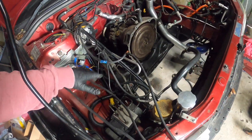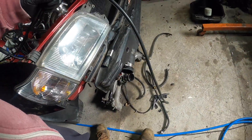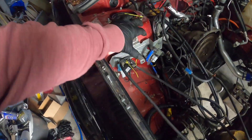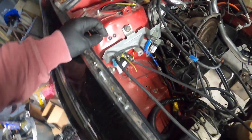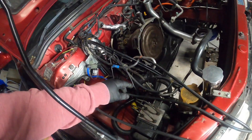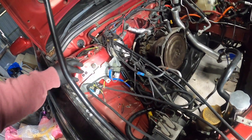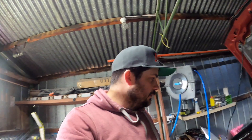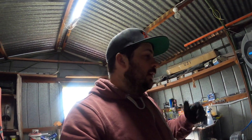I'm playing in the engine bay right now, just looking at all the vacuum lines - there's so much length. I have two wastegates down here and the three port up here, so there's so much there. That's going to be getting a lot shorter because everything will be up here now. I'm starting to think to put a 50mm first to control the T05, so once it does open we're going to get a lot more flow to the GT35. Use a 38mm to control the GT35 and actually have the three port on the GT35.